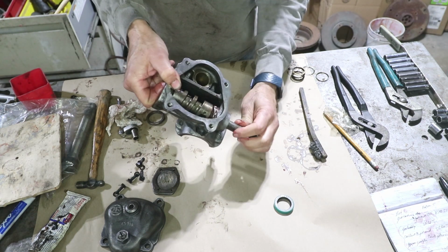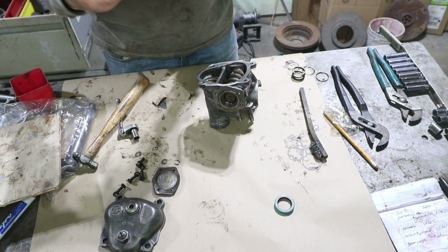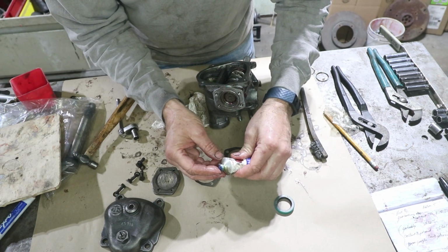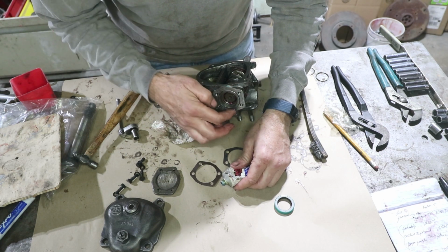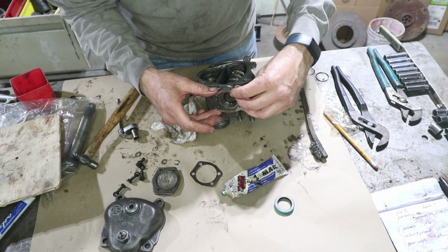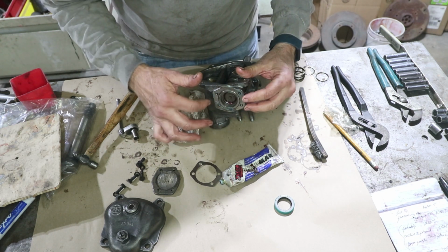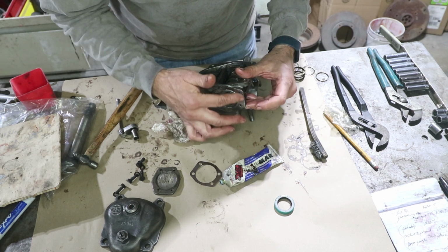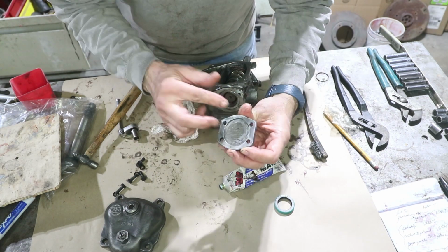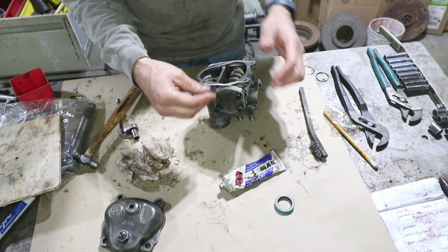Sometimes this lower bearing can get cocked sideways. There we go. I'm going to use something called Hylomar. It is a never hardens, impervious to fuel gasket maker and thread sealant. We don't want to change the thickness. So we'll torque this down right away, but this is real light, so it's not going to change the preload in the bearings. I don't think we need to use any sealant on the threads because these holes are blind holes. They don't go all the way through.